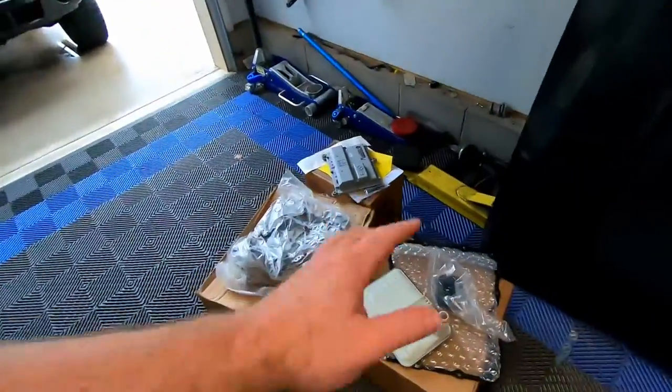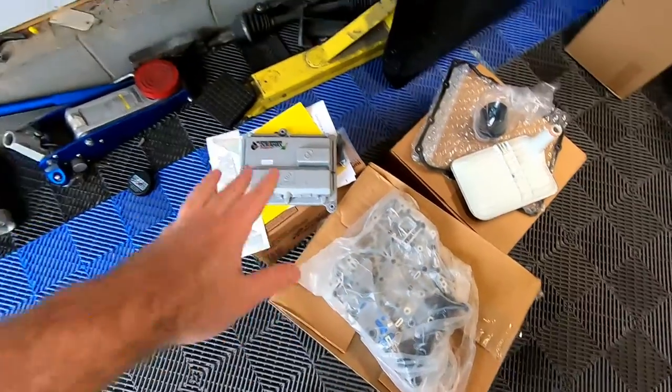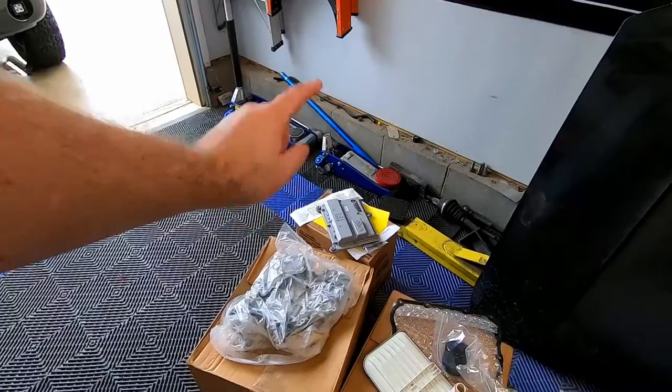The sixth gear has always been in there since the very first day of production, but for whatever reason - maybe they were just waiting for a mid-year refresh or update - they just didn't put it in those trucks. I've heard various reasons like the TCMs weren't ready, the technology wasn't ready. Here we are with all the parts from Duramax Tuner. I bought the filters and stuff from Amazon. Long story short, we will see an improvement on highway mileage, probably like one or two miles per gallon. The biggest thing is you're basically dropping the transmission down about 300 RPM when you're at like 70-75 miles an hour. The components from Duramax Tuner are basically just the six speed valve body and the reprogrammed TCM.